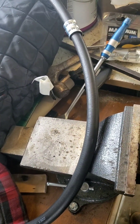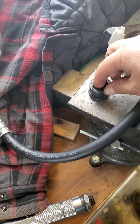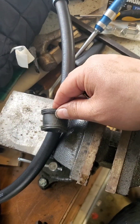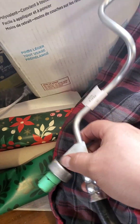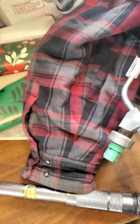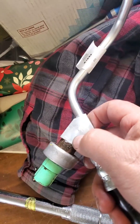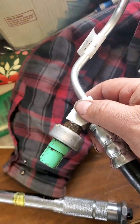Once you put this back on the hose — sorry for the short video — it's simple, just a little bit of a pain to get to. Once you put this in here and put back your steel bracket, you got to take your sensor off from your old line. That'll be a little pain because there's almost no space — you'll need a 17-millimeter to get in here. Luckily the set I bought is pretty thin, but my other wrenches wouldn't fit, so you'd either need to grind down a wrench or find one thin enough to fit between the two components.